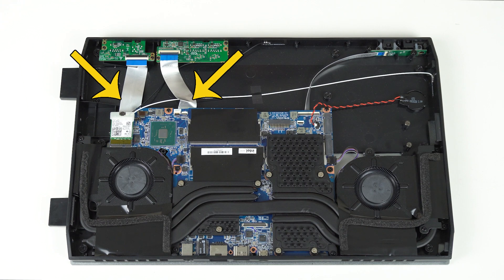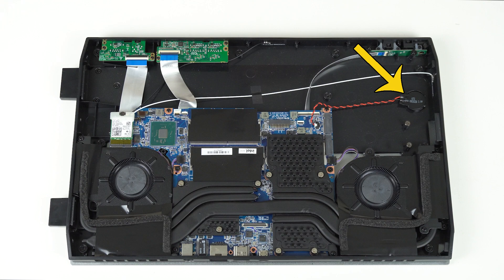As long as it works, right? The CMOS battery is easily accessible, but there are no thermal pads or heatsinks included for the M.2. Also, there's no heatsink on the Southbridge either, which controls storage, IO, and other stuff. That's disappointing, as it gets pretty hot.